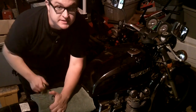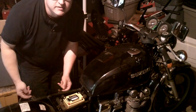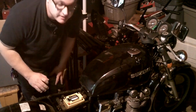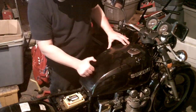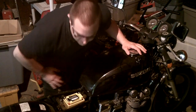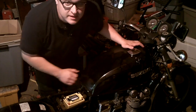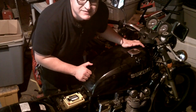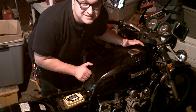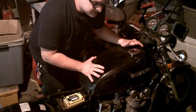The first thing I did is I took off my seat and just took it all the way off — it's gone. I took the nuts out. It's much easier this way; you don't get any problems with it being in the way. The next thing you do is take off the tank. This can be a problem because your tank will have some gas in it, but it's not that hard. The trick is to have a good place to put the tank. If you put your tank on the cement, it's going to fall, get dinged up, and you'll have to paint it.